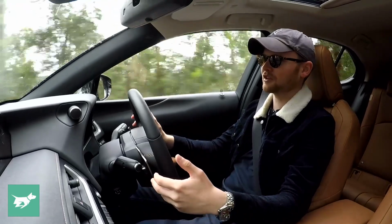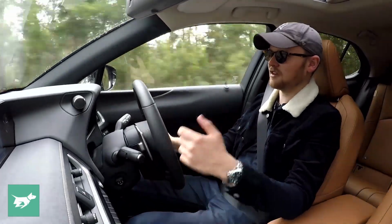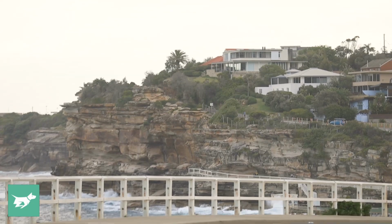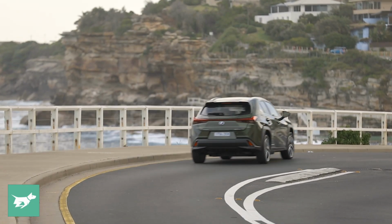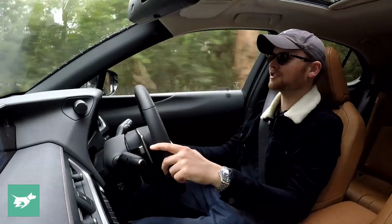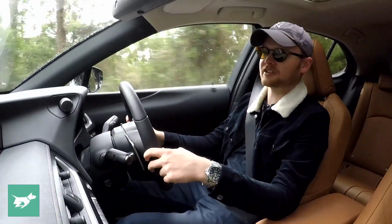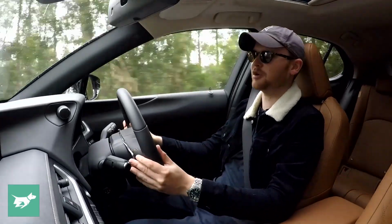Right now I'm driving the car in B mode in the single speed transmission, and 4 down arrows of regeneration, which is the most aggressive that it gets. And when you lift off, there's sort of half a second of no result, and then it starts to just decelerate gently, but it's not hugely aggressive. It's nowhere near as aggressive as the pronounced regeneration that you get on a Tesla Model 3, or even on something like a Nissan Leaf with the e-pedal.